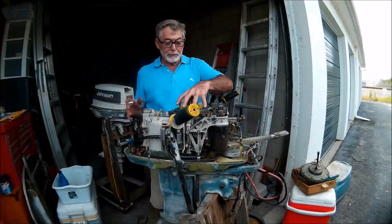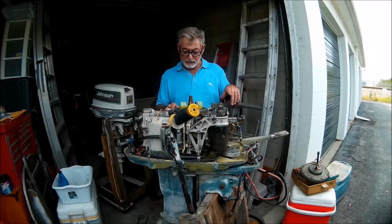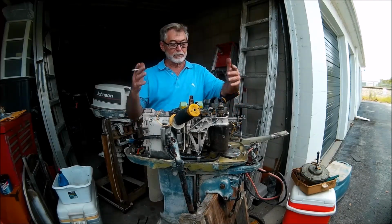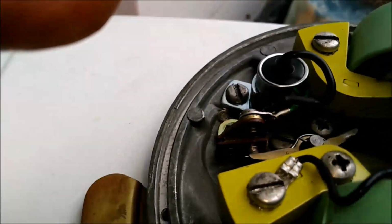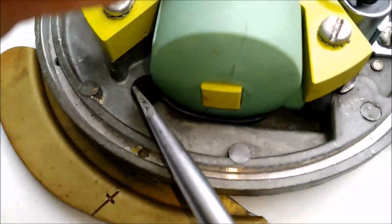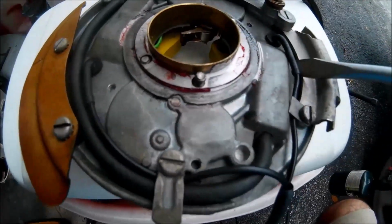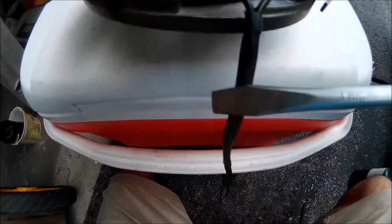Okay, I'm going to rip through last week, tell you what I did real quick. I had to tear everything apart, rewire or add some wires for the vacuum cutoff switch. Got everything wired up. Finally found the schematic. I also took some marine grade heat shrink and heat shrinked all my wire connections. Rewired, resoldered, rewired the original kill switch that was on there. Everything I needed to take care of to get this thing in the water.